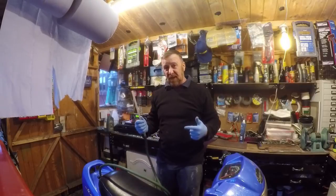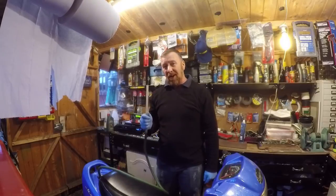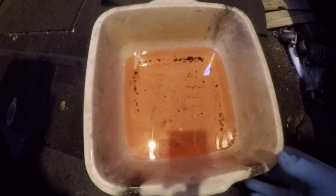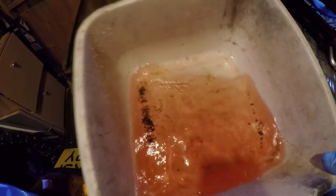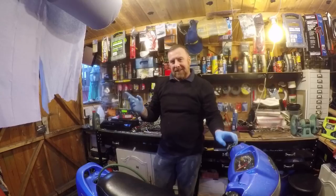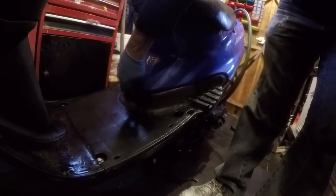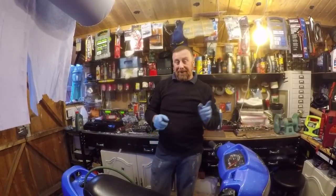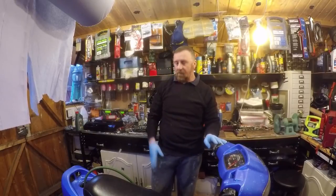Let's check the petrol — let's have a look. I don't want to get too much petrol in my mouth, so a longer tube than last time. I can see the petrol coming up. All them black crappy bits are not supposed to be in there — this was clean before. And can you see a little tinge of pink in there? So it's pre-mixed. Someone put pre-mixed petrol in there.